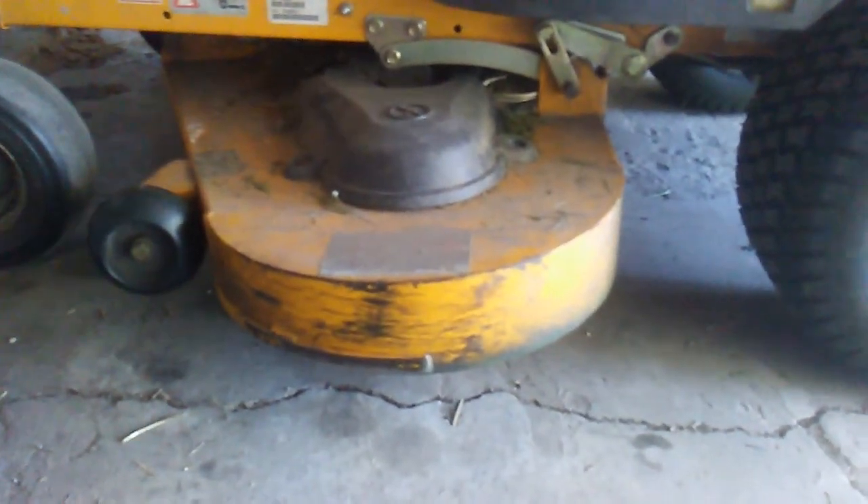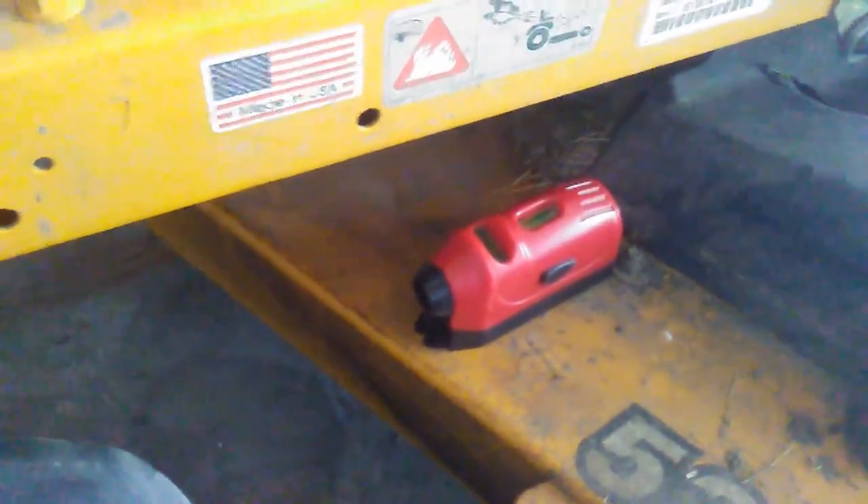So let's try that. I got a little bubble level on there, and you can tell it is not level. This mower deck is definitely hanging forward. In order to adjust it, all you need to do is turn this nut on here if you have this type of mower. Your type might be a little different, but most mowers I've seen have the same front hanging system. If you tighten up this nut, it'll pull up the front of the mower deck.